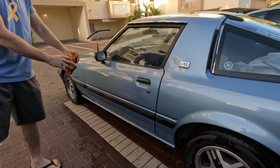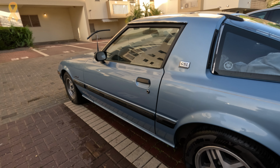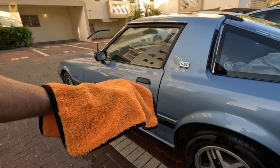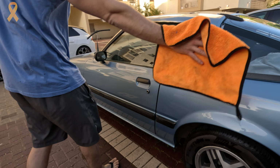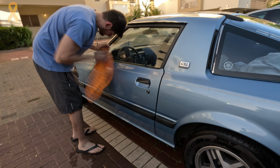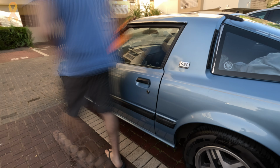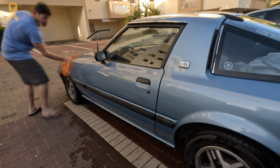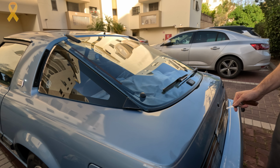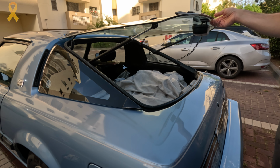After the initial drying, the car is still slightly wet. Now we will use the second clean towel for final drying. The important principle is to dry while the car is still a little bit damp to prevent water spots on the paint. Don't forget all the small corners, mirrors, and any place where water has gathered. If water got into spots like under the rear windshield, lift it up and wipe it from the inside too.